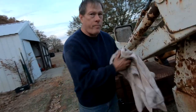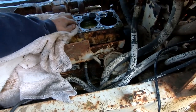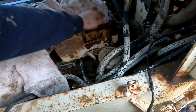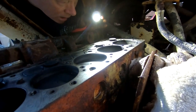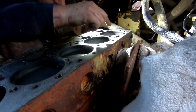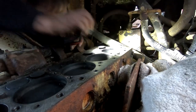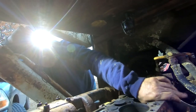Number one is broken. Is that the reason why it got zero compression? Yes. Because it was loose up there - I was able to push it right down. The question I have is: why do we have a broken piston? Tear it apart and find out. Is it a bad problem? It's a serious problem. That one had rust in it - it's just sitting there. But it looks like running the engine for a while has helped it a little bit. Still, there is some kind of pitting or something there.